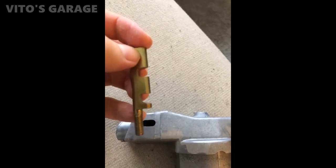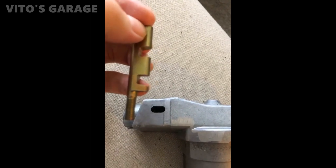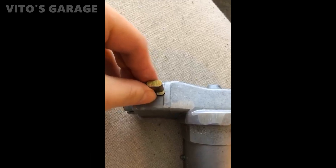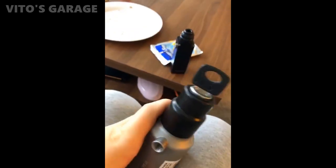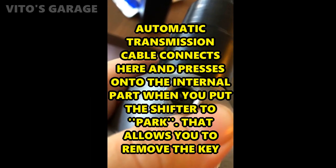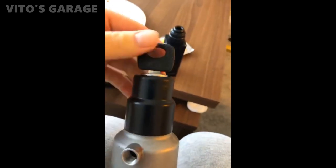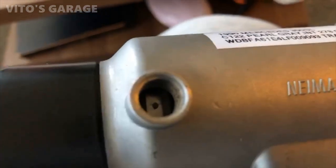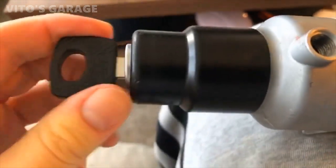If you were to drill this one, you have to drill it on the right side so the locking mechanism gets destroyed. The key won't come out because the cable wire cannot sense or feel any resistance from the gear — from the transmission. That's why you can't get it out. In other words, you need to have the cable connected to eject the key. Once I connect the cable here again, this will pop out.